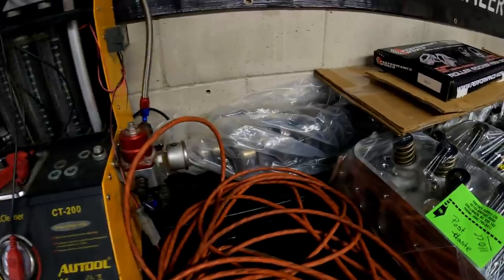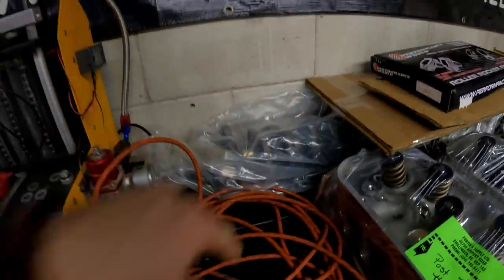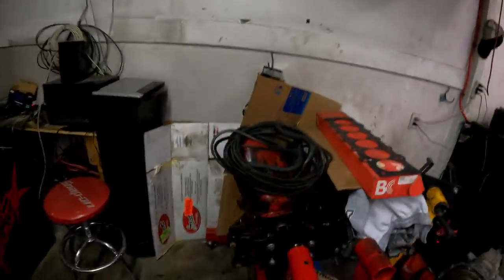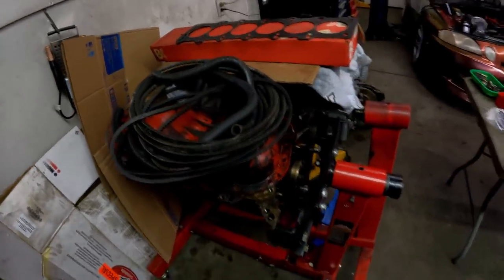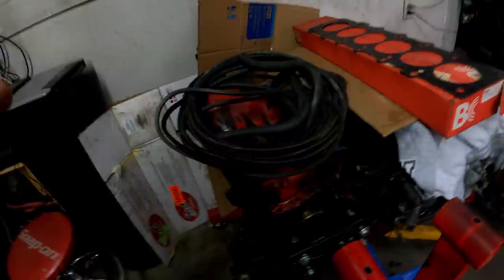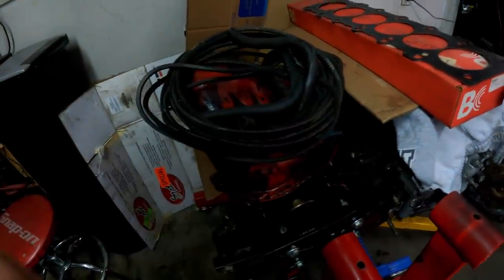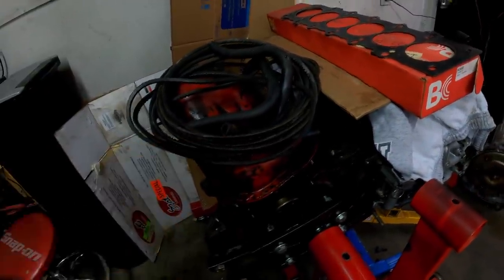If you look over here, this is my 2.5 crankshaft from the Penta motor. I know you guys have been waiting for years almost at this point for me to build an NA motor, and we're just kind of hung up on the piston side of things. The pistons that we had for this block are too small. If we're gonna do it, we want to do it right. We don't want to be putting pistons with a ton of slop in them, too small for the bores. And we are going to be boring this block out.